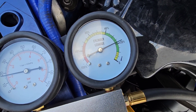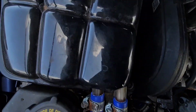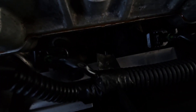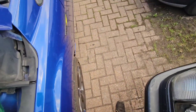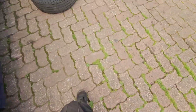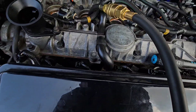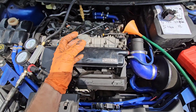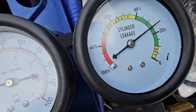Let's try number two - this one's about 22%. These little divisions are 5 each, I've just worked out, so that's 22. Water's okay. You can hear air coming out here. Let me just check the exhaust. Number two is 22%. Right, number three - here's 25%. I can hear air coming out of here so I'm pretty sure it's the piston rings - it's blowing past the piston rings with the valves both shut because it's at top dead centre. And this is number four - that's 26%.